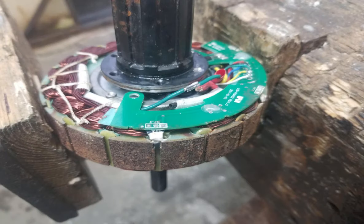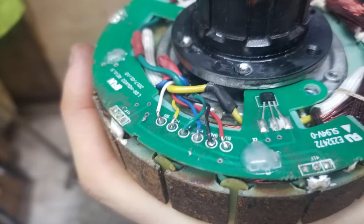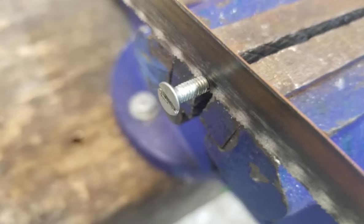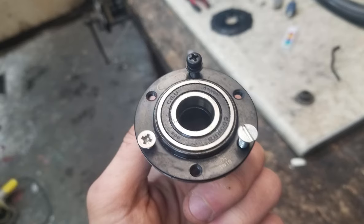Next, join the three main power wires. Use some heat shrink to protect against short circuits. And there it is — the cable is fixed. With some new screws to replace the ones that had to be drilled out, the repair is complete and everything is ready to go back together.